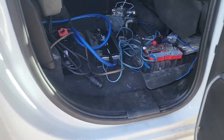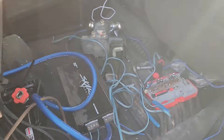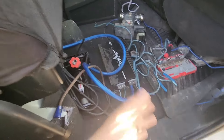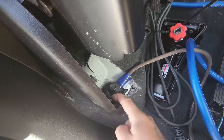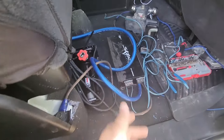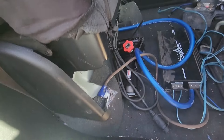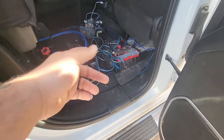My ground — I'm not powering a big system, as you can see this power wire is overkill for what I have. For my negative I grabbed it from right here — I used the grinder and went all the way to bare metal. I couldn't get bare metal on this part specifically, but for what I'm pushing it picks up the ground good. It's not like I'm pushing anything major, so this was a perfect little spot to get my ground — it turned on and everything worked.